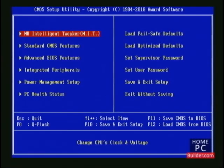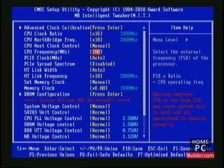Before we start overclocking the CPU, we first need to find out how far we can push the reference clock. The reference clock doesn't contribute to performance itself, but it can be used to fine-tune the frequency of the CPU and other components, making sure we get the maximum performance they are capable of. If you have a non-Black Edition CPU where the multipliers are locked and cannot be increased beyond their stock setting, you will be using the reference clock to do all of your overclocking.